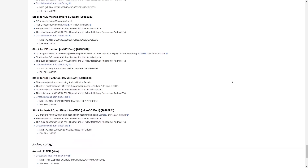For example, I assumed — as I was used to the Raspberry Pi — that if I got the leading distro, downloaded it, installed it, plugged in the SATA card and drives, powered it up, everything would work. But I found that when I tried to access the SATA drive, the whole thing would just freeze. After searching online, I found that only some of the distros in that long list actually support the SATA drive. I could only find one that ran on the command line — there wasn't a desktop version — and only with that one could I use the SATA connector.